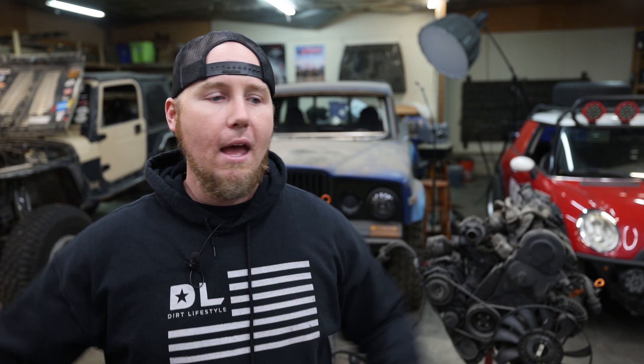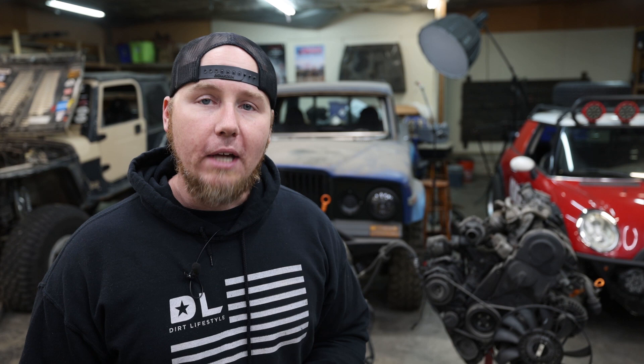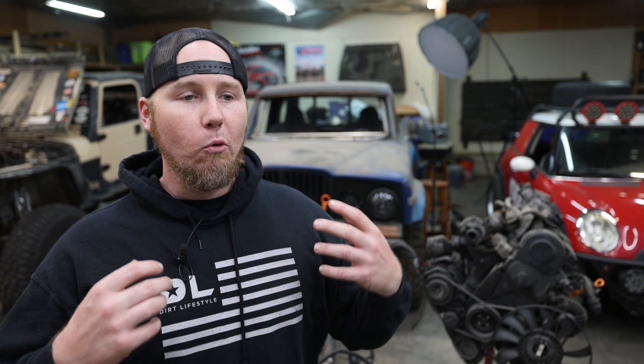My goal now, instead of 400 or 500 horse — and I use those numbers very loosely — is I'd be very happy with 300. We're still going to have spray available with nitrous, just for fun. We're going to be using two turbos now instead of one, so we should have plenty of boost. The goal is to make it more reliable and more powerful. The rods we're using are good for a thousand horsepower and the valve springs for way higher RPM, but we're not going there. With the head studs, bottom end girdle, and everything we're using, this is going to be more reliable, more fuel efficient, and more powerful.